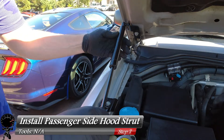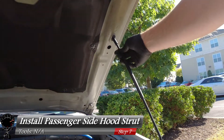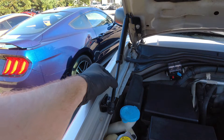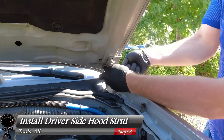Alright, we're almost done. Let's go ahead and install our hood strut. Let's pop the top on, and then we'll go ahead and set the bottom right there so we can move the hood prop rod out of the way. We need to lift the hood a little bit higher — as I'm moving the hood up you can see it makes it easier to install the bottom pivot point, and it snapped right in. Repeat the exact same steps on the driver's side as well.